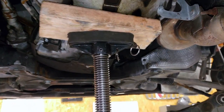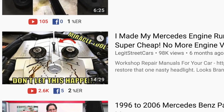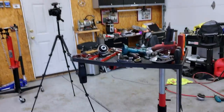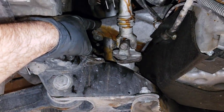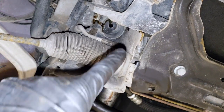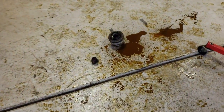I've already taken both engine mounts out - these are just about the easiest engine mounts to replace on any Mercedes-Benz. I'll link a complete engine mount replacement video I made on my C55 down below. For this CDI, remove the two bolts for the transmission mount, jack up the engine using a block of wood, and get the $20 Miracle motor mount tool. That tool lets you get to the top bolts quickly, in a couple minutes instead of struggling with a wrench forever. All you have on the bottom is a 13mm bolt. With the engine jacked up you can take the motor mounts out the backside without removing anything else. You can get this job done in about an hour.